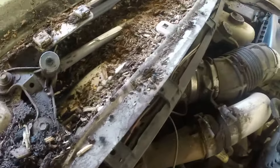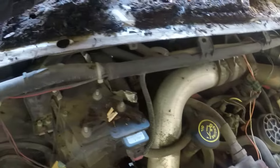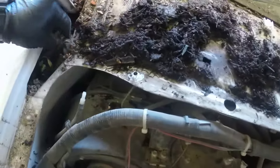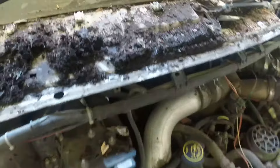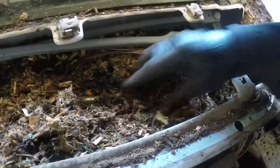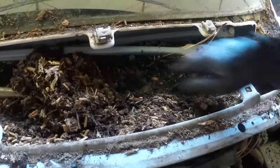As you can see there's lots of dirt and everything is wet — that's not a good situation. I already troubleshot the relay load side, control side, and ground a few days ago, but I didn't have my camera with me. I will make a video later on how to troubleshoot the relay, check for ground and power on different sides, and check the fuse as well — that's always the first thing you want to do.